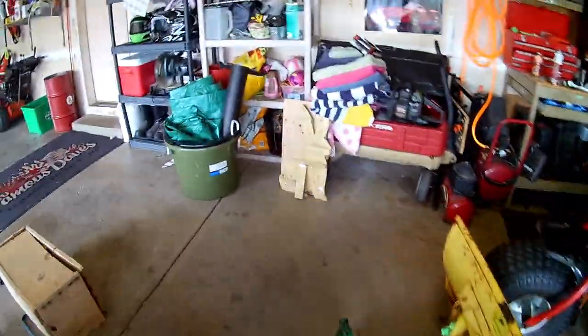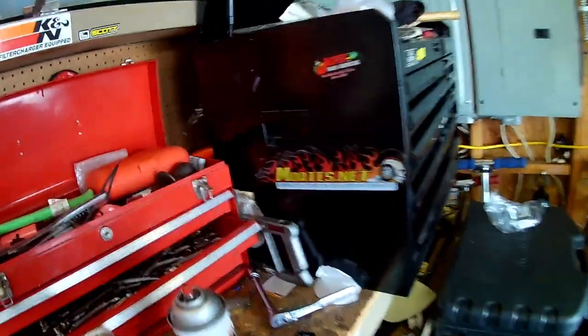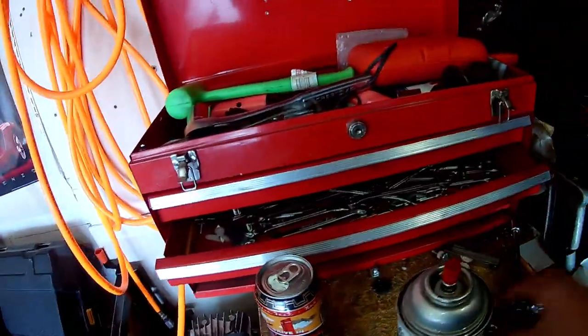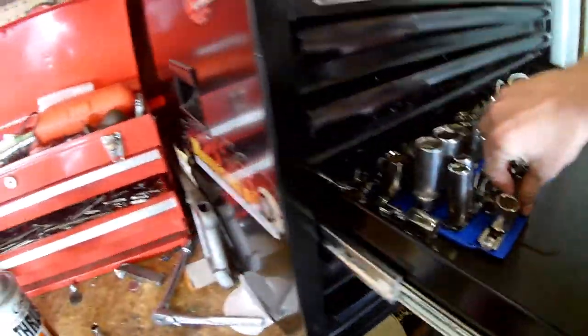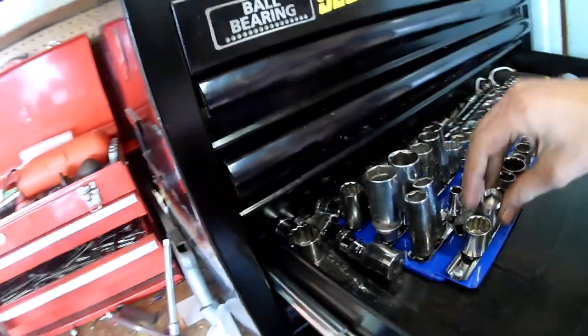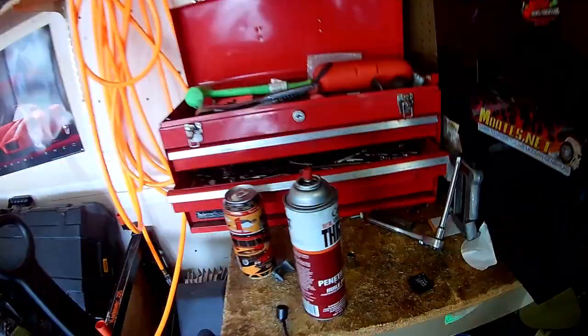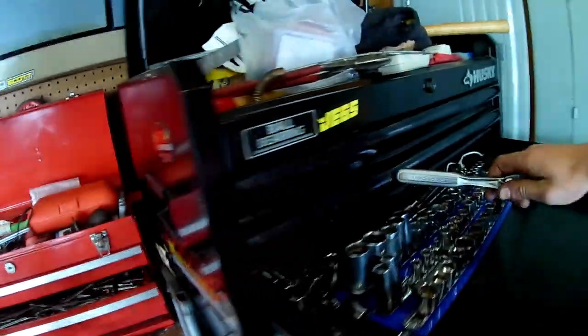It was ripped apart. The fuel tank was up. I was putting a starter in it. It's a pain in the ass to start on this thing. To be honest though, the starter in that thing is actually easier than it is in my 110. The 110 has a plate that is part of the engine mounts and covers the bottom bolt, and you have a heck of a time getting a wrench in there. I'll tell you that much.